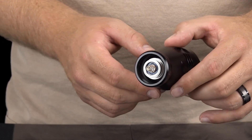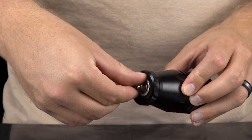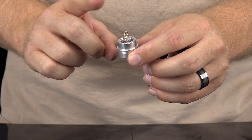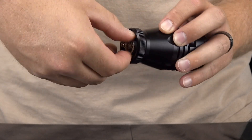When you look inside the bezel, you will see the bottom end of the LED assembly. Remove the LED assembly by carefully gripping it on the edges and gently unscrewing it from the reflective housing. Do not unscrew the LED assembly by twisting on the attached spring — if this spring breaks off, your LED will not work.